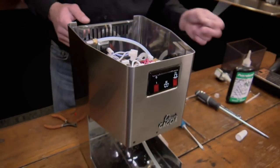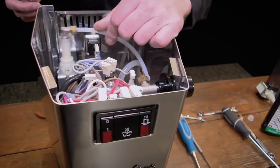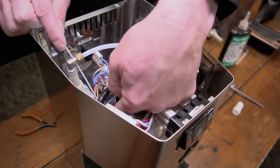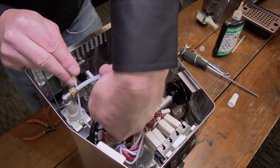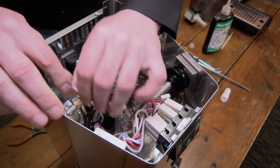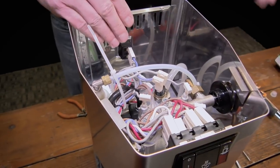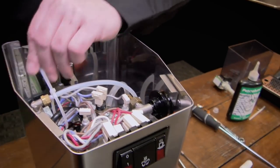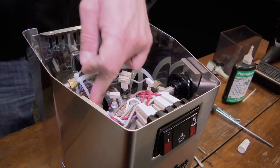The last thing I like to do — the pump flops around a little bit, so if you're moving the machine around and it gets dropped, the funnel can hit the top of it. I'll just run a zip tie around this bunch of wires and zip tie it. You don't want to go too crazy tight — you don't want to put a lot of pressure on it — but you can see how it holds the wires back. It keeps them from flopping around and going underneath the funnel area where they can vibrate and hit the black area of the funnel. I always do this whenever I repair a machine. Put the zip tie on there, cut off the excess.